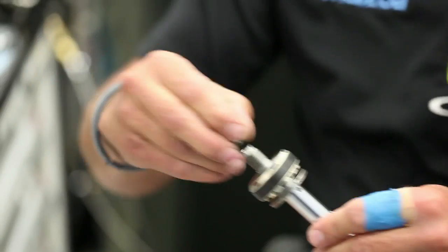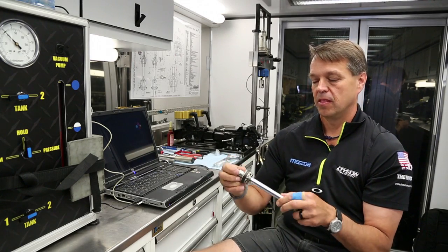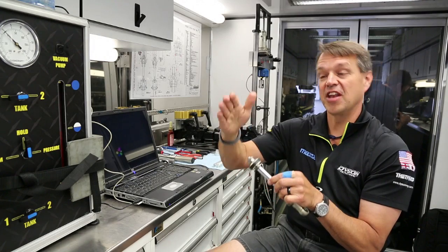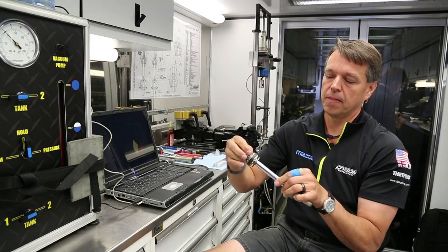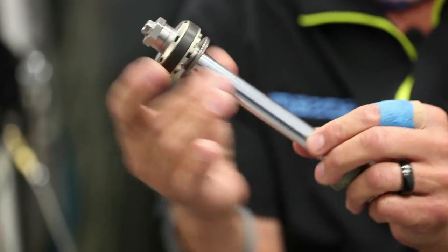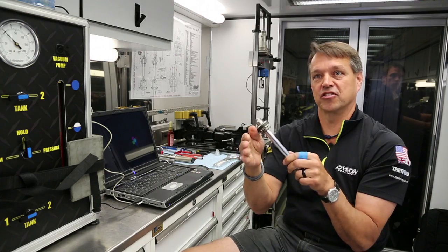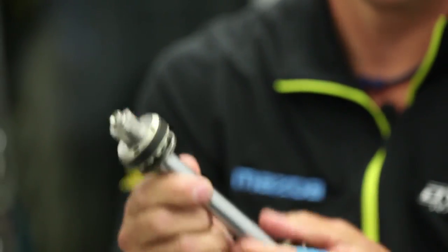The way this works hydraulically: the piston is inside a tube, and as the shaft moves, the oil on each side of the piston has to flow through the piston to get to the other side. That oil is under pressure from the nitrogen gas. There's another set of shims called a head valve on the nitrogen side — as the piston moves, it resists oil from displacing the nitrogen in the canister. Some of the oil is forced through the piston, which gives you your initial movement curve and your low-speed behavior. The shaft also displaces oil inside the tube — that oil has to go somewhere, so it goes into the canister where the nitrogen is, flowing through the other set of shims at a controlled rate to change how the shock moves.